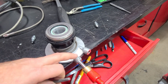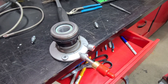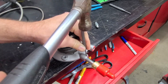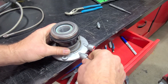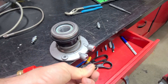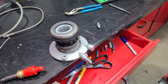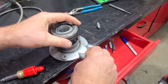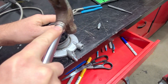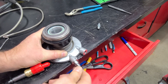Once you have all your tools, go ahead and knock out that roll pin. I open the drawer here so when the roll pin falls out it falls into the drawer and not on the floor, so make sure you have something to catch it. Now just remove the factory fitting — make sure that you get the seal out from what was on there. The new one will have a seal. Then you just take this, pop it in, take your roll pin and reinstall it. Now your new fitting is on there and ready to have your clutch line installed.